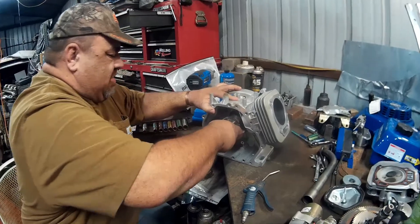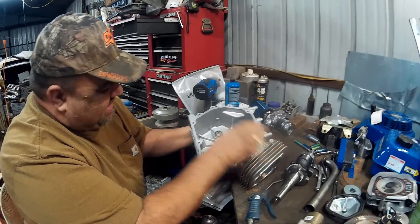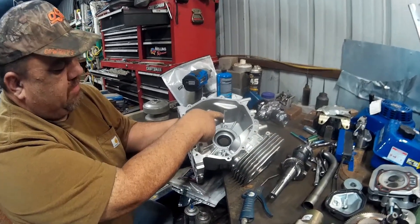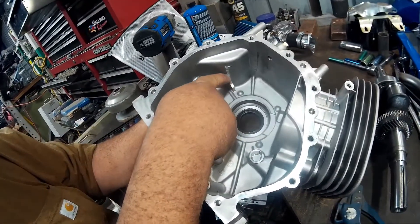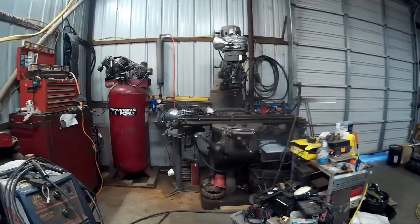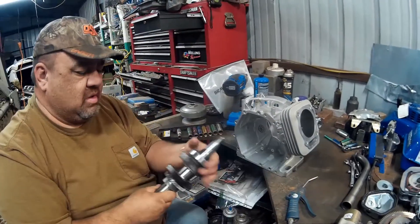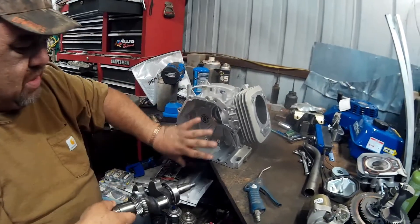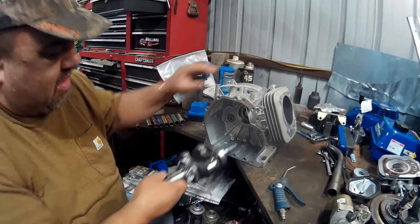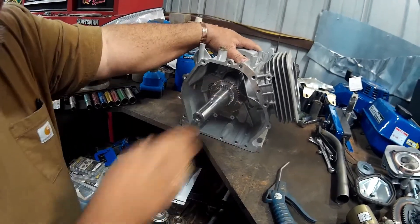Here's the bare block. I just stuck the crankshaft in it but we'll pull that back out. You can see this vane here — we milled that down on the bridgeport off-camera, right over there. That's so the ARP rod bolt will clear the crankshaft. I've already blown the block out and the exterior off with air, and blown the crankshaft out. The bearing slides in there.